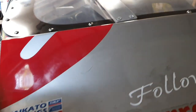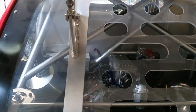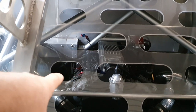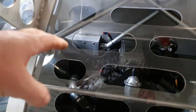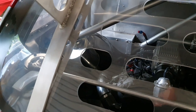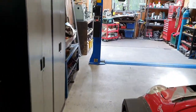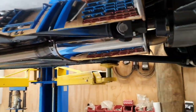It's supposed to be rated for like 1200 horsepower but it's a bunch of poppycock — I just want to confirm and prove it. At idle just sitting in the garage, once everything's up to temp in the engine bay, we're seeing 44 degrees out of the turbocharger because the compressor housing is all bolted up and hot exhaust heats the air even at idle. We're getting about 30 coming out of the intercooler, so it works at idle but not well on the racetrack.